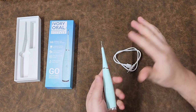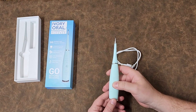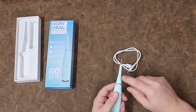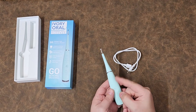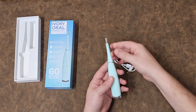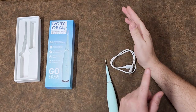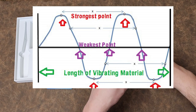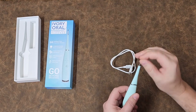As I turn it on, immediately — the weird thing about these types of devices is you can feel the waveform as it propagates. There's probably a small motor with an offset weight that vibrates, and because this long dinglehopper is out there, it's going to vibrate the tip. The problem is if the tip isn't at a tuned length — waves go like a sine — and the apex of the sine wave is where the tip would be at its best. But down near the zero crossing, going from positive to negative, that's when it would have very little movement and power.